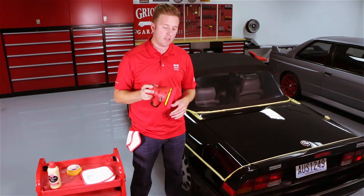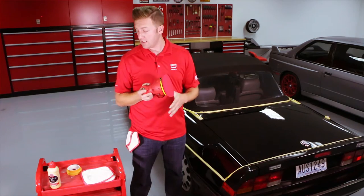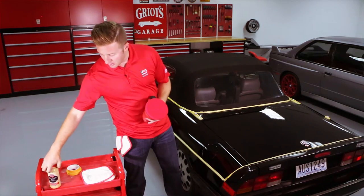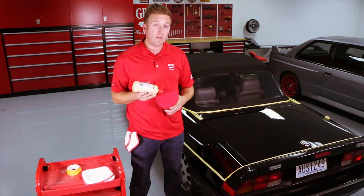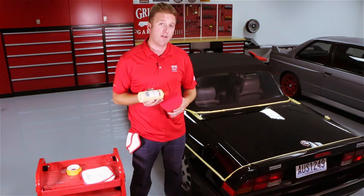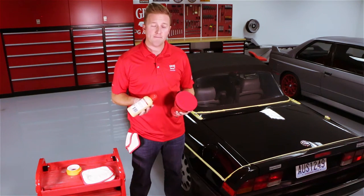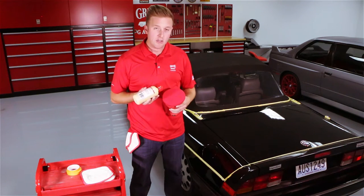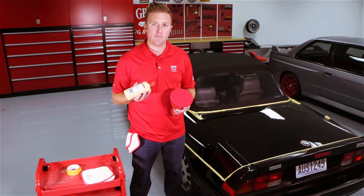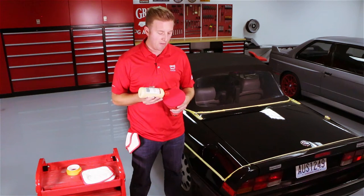I've chosen the lithium-ion as my machine of choice. I've affixed a five-and-a-half inch red foam waxing pad to it, and for my first application I'm going to butter the pad just like I would in any other correction process. This is going to be too much product for the small area I do initially, but it makes sure that we don't put any dry foam onto the paint. Every step afterwards we're going to use less and less product. The key to this liquid wax is less is more — just keep that in mind on every application after the first.